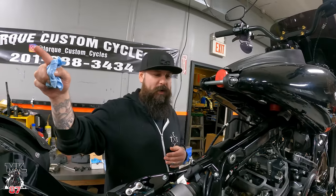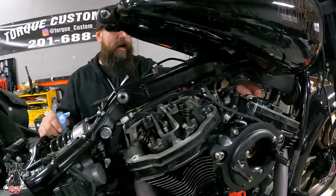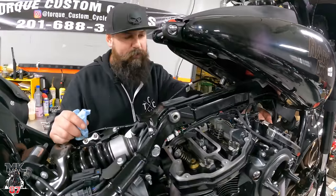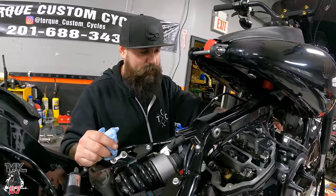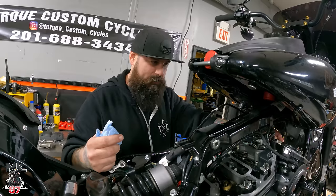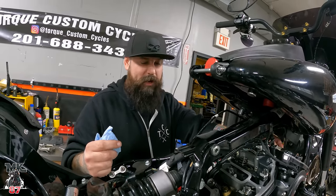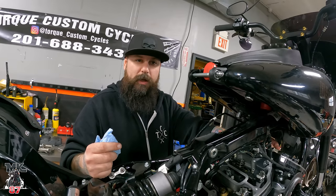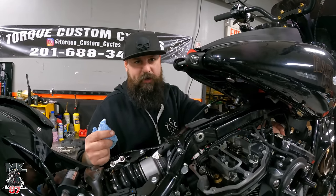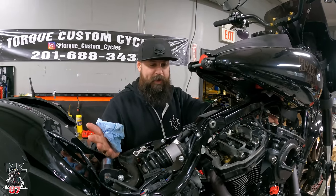On the one we have apart over here, if you do a side-to-side or end play motion on those, I measured between 4 and 5 thousandths of end play on that other bike, and yours has between 15 and 19 thousandths of end play between the exhaust and the intakes. So I'm really banking on the hope that it's just a lot of space for it to rattle. I'm feeling that what you're hearing is your rocker arm shaft doing this while the bike is running. I'm going to pull the lower rocker box now.